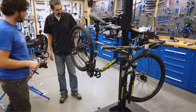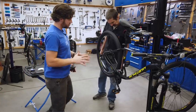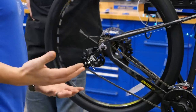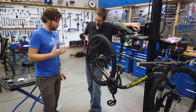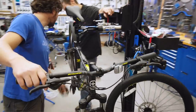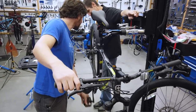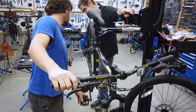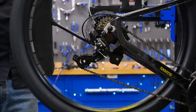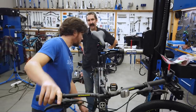Let's see if it shifts. We've got a brake rubbing but we'll hit the brakes last. These gears — I'll be honest, I don't think they're going to be very good out of the gate. One click, no movement. Two clicks, it's there. There's some noise, we're jumping around — sixth, first, fifth, fourth, third. It's very unpredictable. Let's see if it's the indexing — I'll thread out this barrel adjuster, give it some false housing length, take out the slack. And there it went.